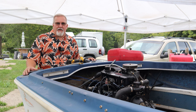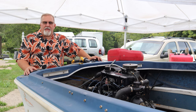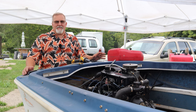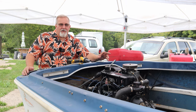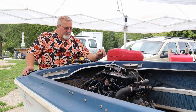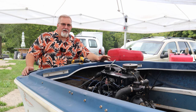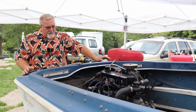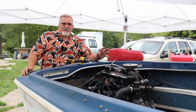Hi there folks and welcome to another episode of Michael's Backyard Marina. You might be asking yourself why are you back out here by the old '73 Larson — I thought you had this engine running good. Well this is part three. We're going to check out a few things. After we ran it for at least 40 minutes on the hose, remember the old oil from episode one — that caramel-looking solution loaded with gas. We put in brand new 30-weight NAPA oil and a NAPA Gold oil filter number 1061, made in USA. My understanding is the NAPA Gold is made in the same factory as a WIX filter.